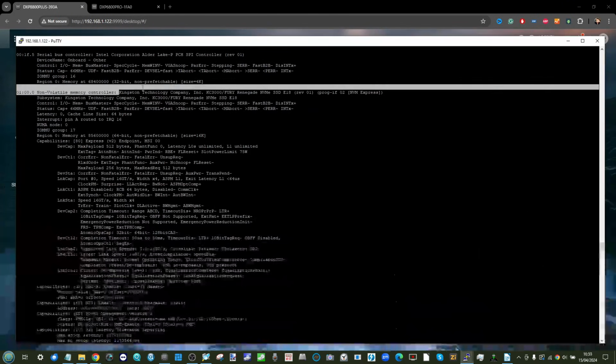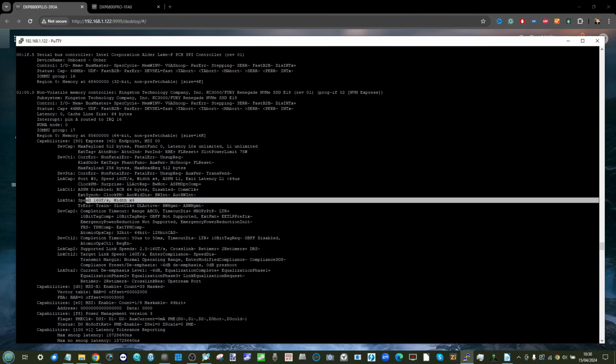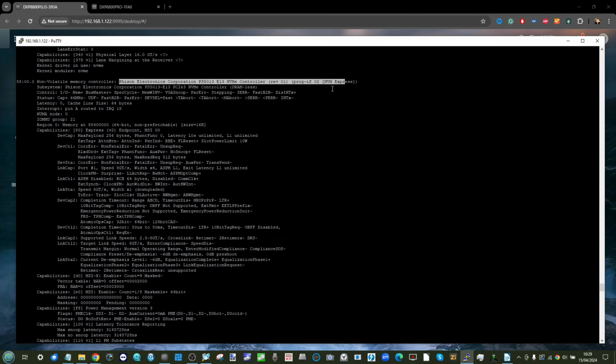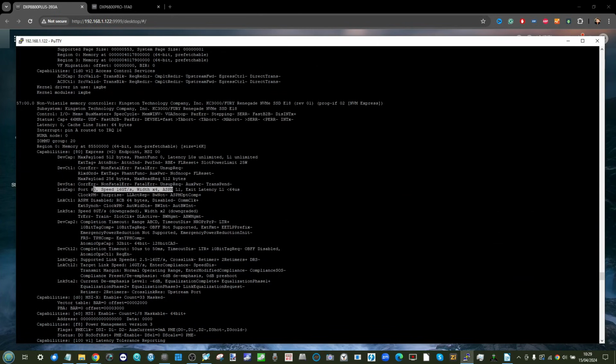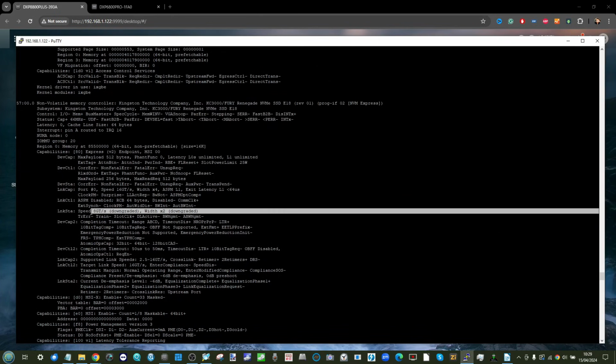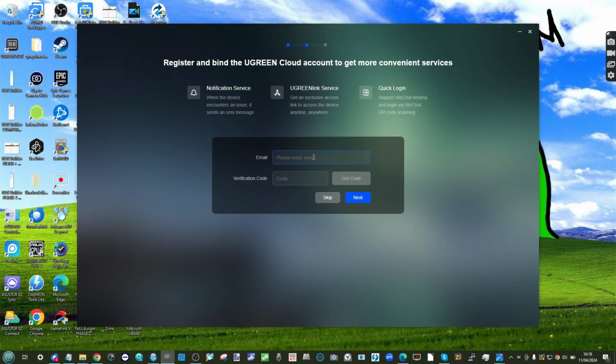So I dug into the PCIe layer of this system, and indeed, the first M.2 NVMe slot is Gen 4x4, and the operating system drive is a Gen 3x1 slot, but that's still 1000 megs for the operating system SSD, that's fine. But the second slot, although it is Gen 4x4, has been downgraded to Gen 3x2, or 8 gigatransfers times 2 speed there. That would only give me 2000 megabytes per second to play with, and that would explain, at least in my eyes, why I was getting throttled when transferring the data, or why my performance numbers were not hitting that full 3 to 4 gigabytes per second of the other drives.